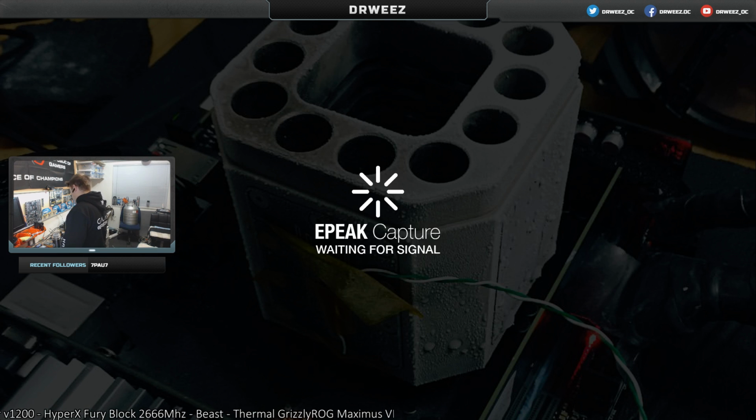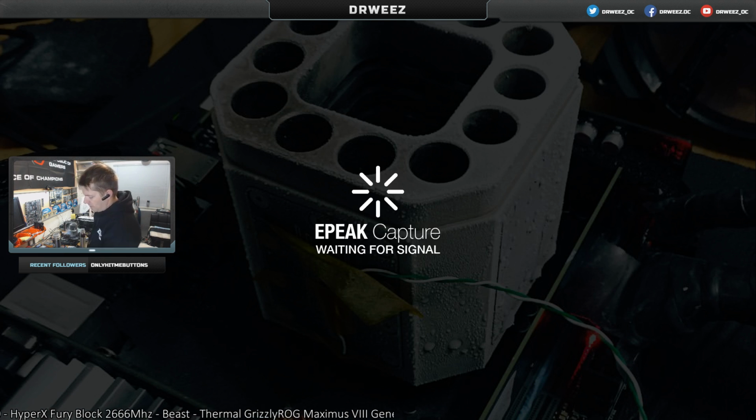So basically, I'm just busy trying to reboot, and I'm getting a bunch of 55s and 41s, and that's mainly because I think the SA voltages are a little bit low. They're all at stock at the moment, and I got the memory sort of clocked up. It's going to cause me some problems.